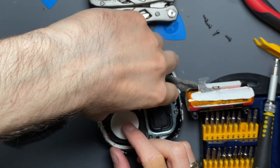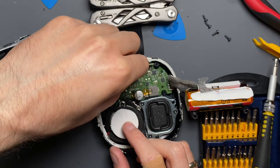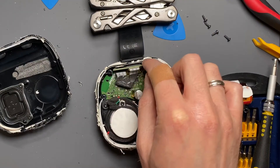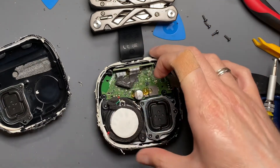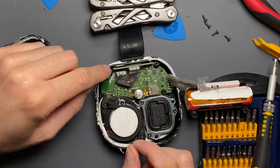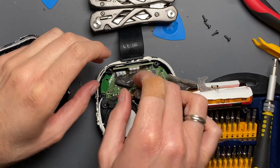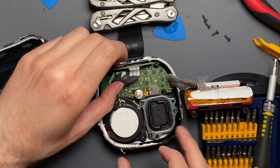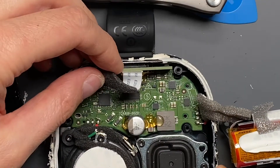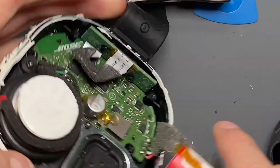There's very small stuff down here and we'll be careful with this flex cable. This board here is for the micro USB, and then there are two buttons that power it on and do Bluetooth things. That's a nice thick PCB — I think it's probably being used for structural support as well, as it's screwed into the plastic. It's a very well done circuit board used for Bluetooth and probably all of its control.